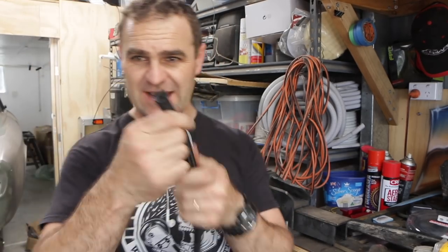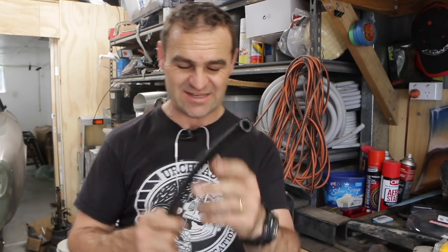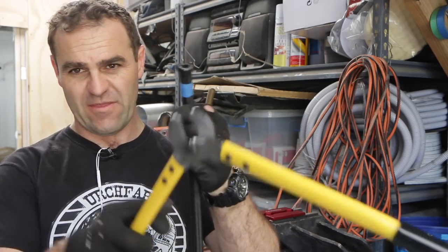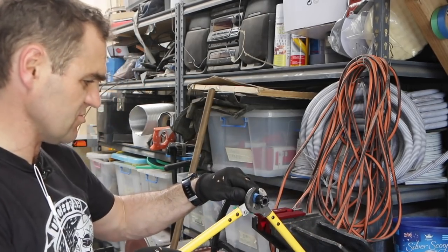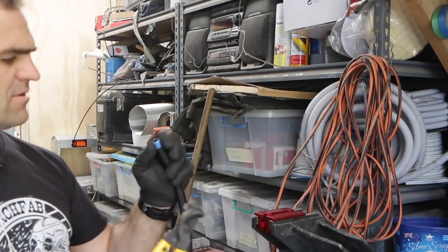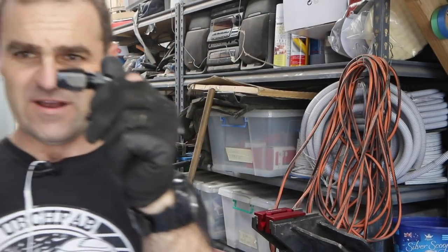What you saw at the start of the video was me using the push lock hose, and obviously that didn't fit. The new hose Raceworks sent me is their 120 series — rubber inside with a braided outside — and this fits perfectly over the end. It's a dash-8, so putting the fittings on this hose is slightly different. Every hose seems to be a little bit different depending on what it's made of. I've taped up where I want to put the fitting and I'm going to cut the end off using the hose cutters through the tape so I get a nice clean square cut.